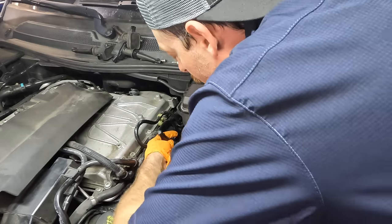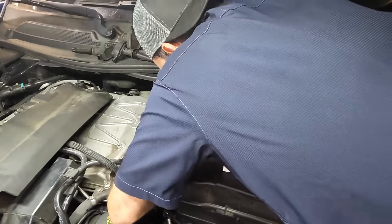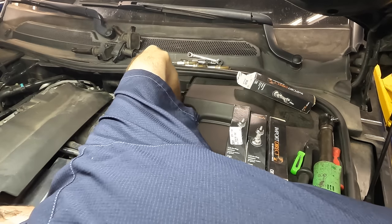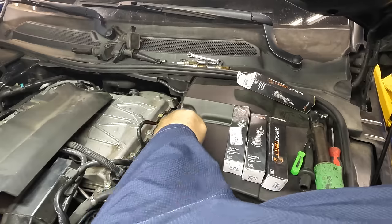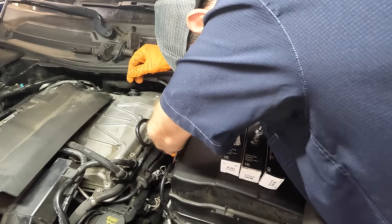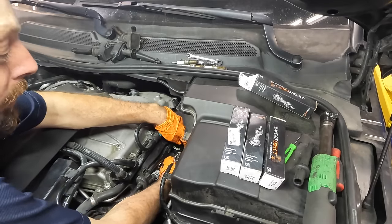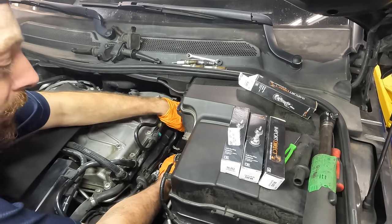What we're going to do is grab our new boot, drop our spring down in there, and slide that guy right back onto the coil. Good to go. Now that our coil has been rebooted, let's give it some dielectric right in the hole there. We can drop her down into the spark plug tube and get this guy bolted in. This is the one I have to do kind of backwards — I've got to fold this boot almost 180 degrees. Good thing it's flexible. That coil's in position — just need to get it pressed down over the plug.